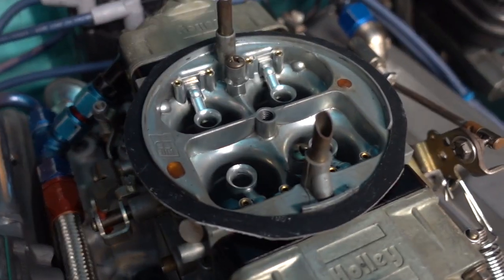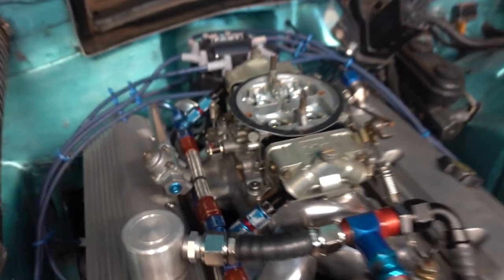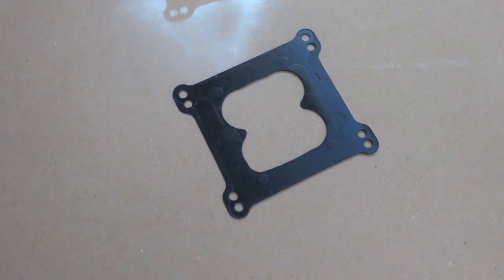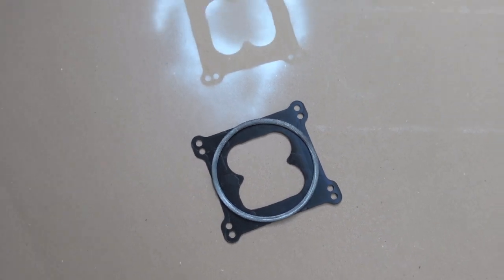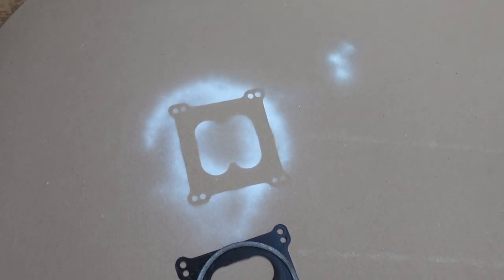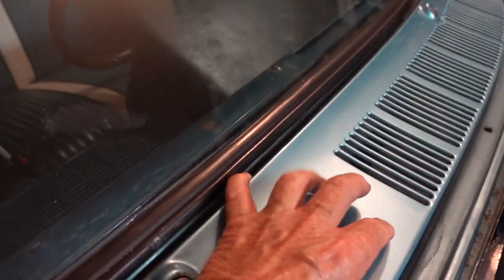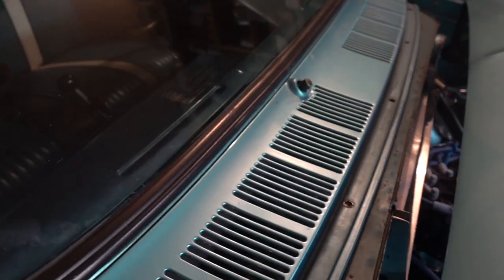Here's another interesting piece — this gasket around the base of the flange of the carburetor. I cut those out of old carburetor gaskets. Just lay the old one on it, give it a quick shot of paint — that marks it — and then you can cut it out. Pretty easy. But that trims it back up, so now you know what's under there.